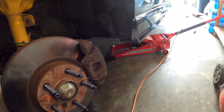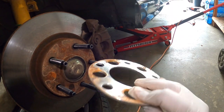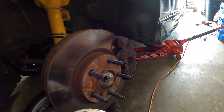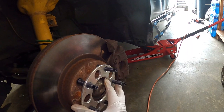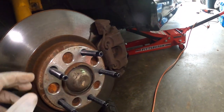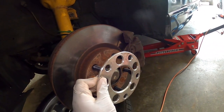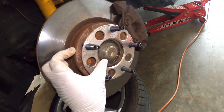All I have to do now is put the spacer. I'm taking this 5mm spacer from the back and placing it here on the front. As you can see it needs a little attention, but I'm not going to clean up right now because I plan on swapping these rotors in the future. To place this 5mm spacer it just goes right on. I want to put a little bit of anti-seize grease here first before I mount everything.